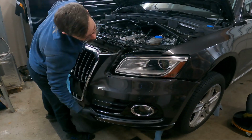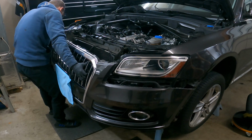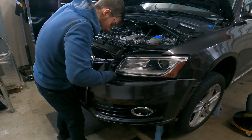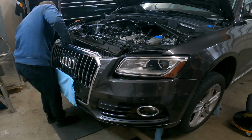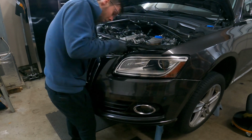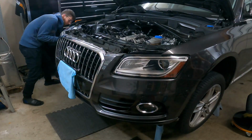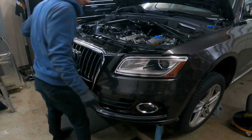So when you're installing the bumper, watch the back corners right next to the tires. Make sure that you don't scratch the fenders up. Sometimes they can overlap and scratch. Otherwise, just line it up with the two holes right up front. Take your time, line up all the tabs. Don't force anything. If you force something, it doesn't feel right, it's probably not right, so take your time.